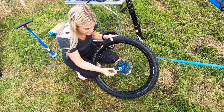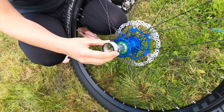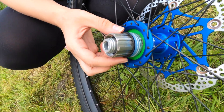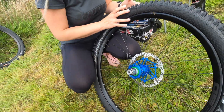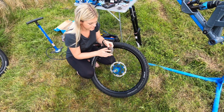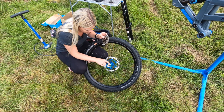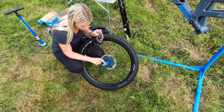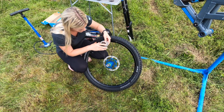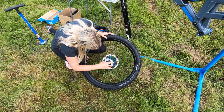We're going to put the cassette on now. Because it's a downhill cassette it is only seven speed, and you have to pop in some spacers which come with it. To tell where to put the first part of the cassette, there are different levels on the splines — you look for the thin one and match them up like a jigsaw. My husband's probably very happy with that technical term!